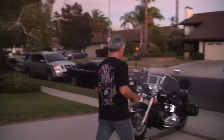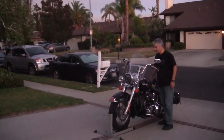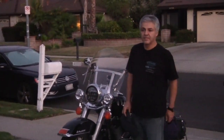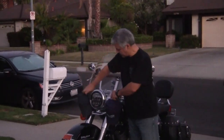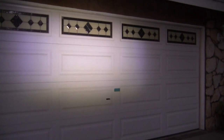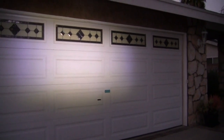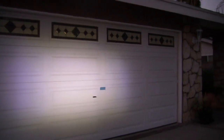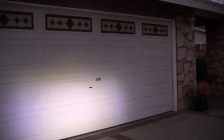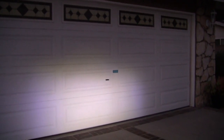I'm going to cover both passing lamps — using a couple of baseball caps, which worked really well — so I can concentrate on the headlight. I'll turn on the headlight, and as you can see on the back wall, the factory setting is way above where it's supposed to be. I've already loosened the bolt that adjusts the alignment, so I'm going to gently move the headlight down. The upper cutoff of the beam is now pretty much below the blue line. That's in low beam, not high beam.